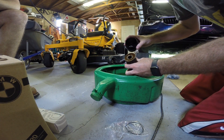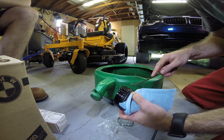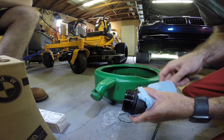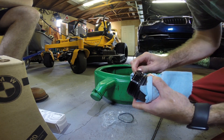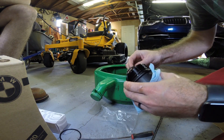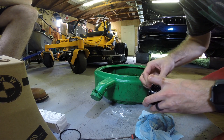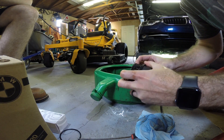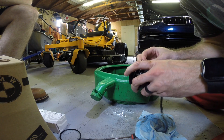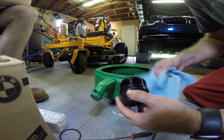Pull this out — it should just pop out. On the cap here there's a little rubber gasket, and the new one comes with a new one on it. We'll get the little pick underneath there, pop the old one off, and go ahead and put the new one on. Make sure you've got a nice light coat of oil around the ring to keep it lubed up.